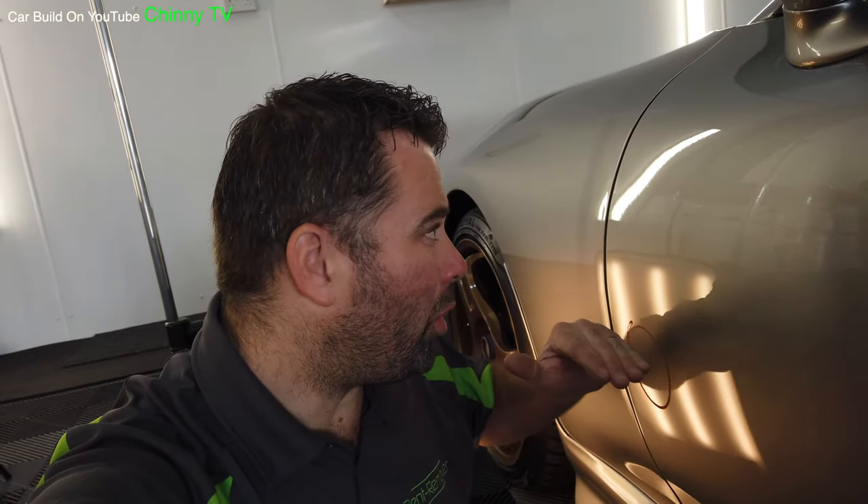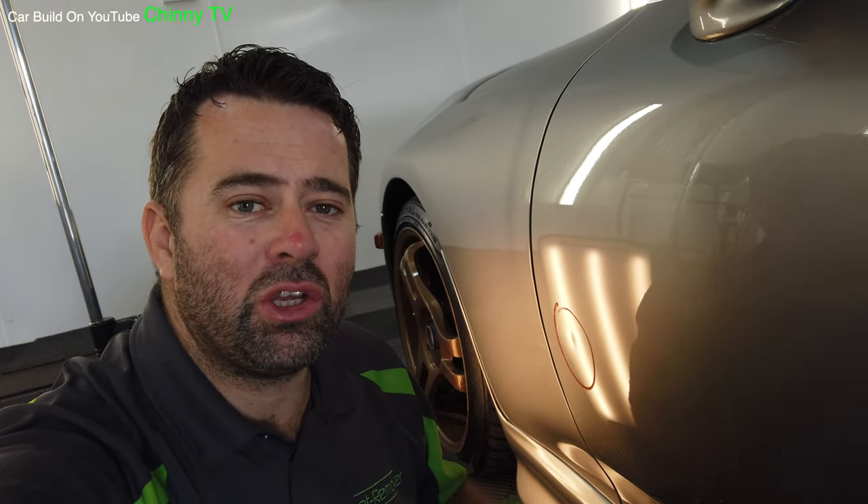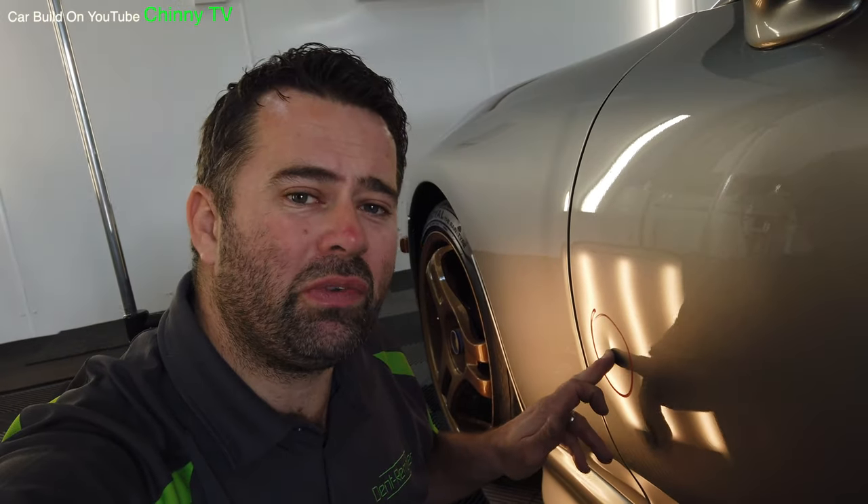We're on dent number three now. It's at the bottom front edge of the door, so it's always going to be a bit of an issue to get to. First thing I'd do is check to see if it's braced — you push it, if there's a bit of flexibility there, there's a good chance it's not braced. If you push it and it's solid, it means there's a brace there. We can also take the window down and get a flat bar in through there. But as the door card's off, it's a no-brainer just to check inside with a torch to see if it's open and if we can get another tool in there that can do the job. If not, we'll take the window down.